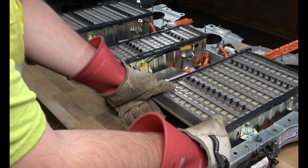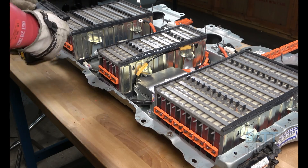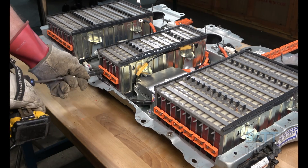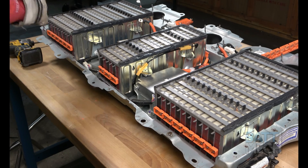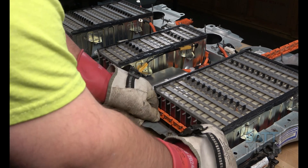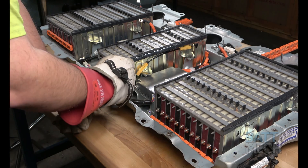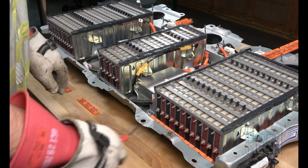Now, on the opposite side of the battery pack, remove the black plastic wiring harness covers. Once removed, proceed by removing the nuts that hold the wiring harness in place — a pen magnet might come in handy here. Once the nuts are removed and you've picked up all loose nuts, you can remove the orange wiring harnesses from this side. If the orange harness is not coming off easily, you can use a small flathead screwdriver. Keep in mind, if you touch any two terminals at the same time with the screwdriver, you may experience a spark — be careful not to do so.